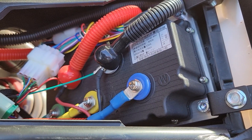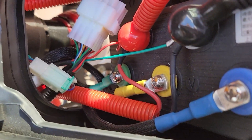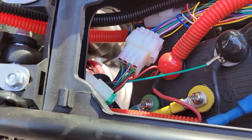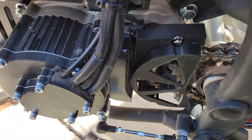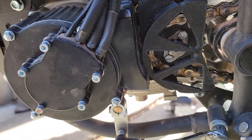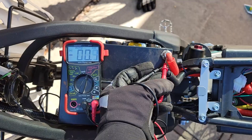Eventually it makes it back into here through these other large wire clips. The green, yellow, and blue wires travel through this zip tie, down past the charger — zip-tied all the way down to the motor. Then that one solid black wire, the fourth one, goes back up to the controller on the far side.